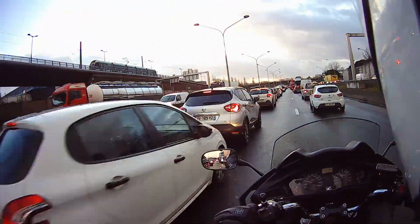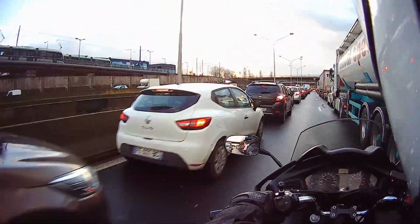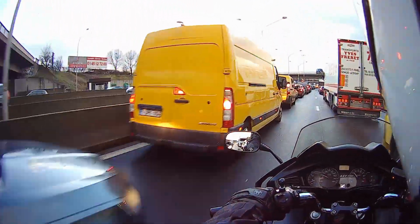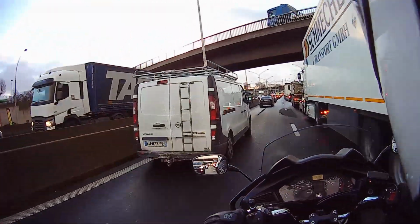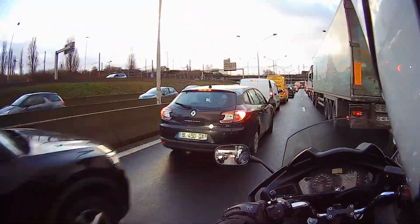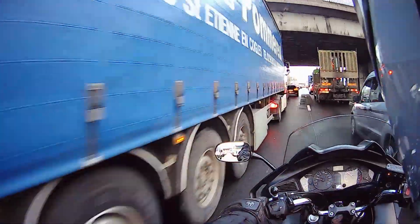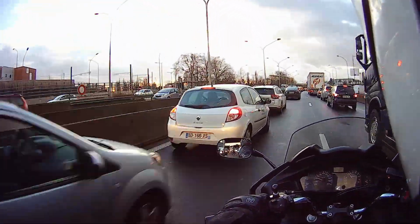Anyhow, the seat wasn't locking down, and so I spent some time looking at why this was. There is a little nut which holds the locking mechanism, not on the seat base itself, the seat pan itself, but the locking mechanism on the bike. And that was catching on it because the gel at the front of the seat has made the seat just that little bit longer. And so consequently, it wouldn't seat properly, if you understand what I mean.